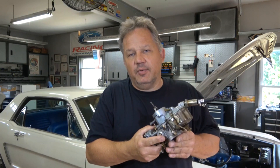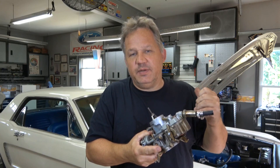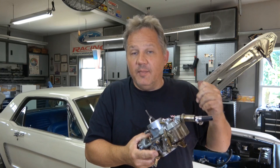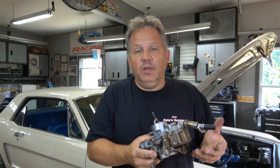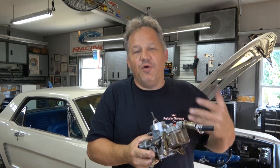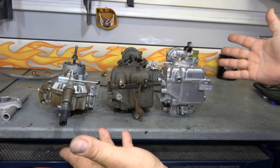The only reason I can't use this carburetor on that engine with that spacer is because the spacer does not have the groove for the idle mixture circuit underneath the carburetor where the hole is, and I do not have a gasket that will have a hole through it to allow the airflow for idle.